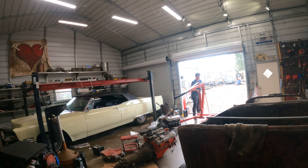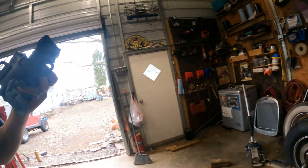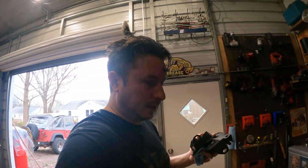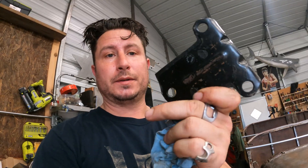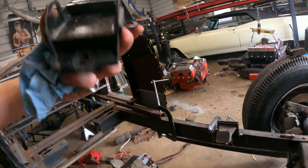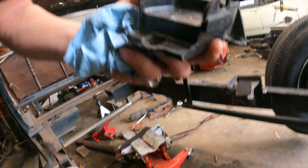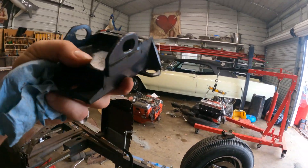For those of you confused, follow along. These are motor mounts — well, it's half of a motor mount. The other half is right here. There's a part that you weld to the frame, and a part that you bolt to your motor. Those three bolt holes go on the motor. On the frame, that's like a rubber insulator. It slides on and gives you enough room to adjust a little bit in all directions. You bolt that down and you have a rubber cushion so your engine vibration doesn't go straight to your frame. Bob's your uncle.